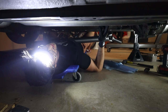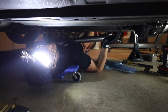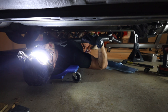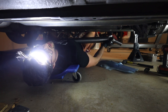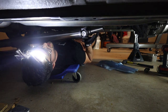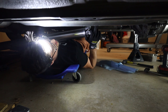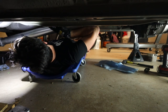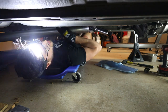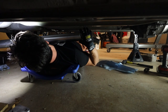I'm sure at some point you guys have noticed this plug, or I've mentioned it, but this plug is here so that the gear oil that I've already pre-filled my transmission with doesn't come spilling out while the engine is tipped at an angle while we're feeding it in. So, see if we can get this up here, the input shaft right here, the yoke that this guy is called, this input shaft obviously needs to go right where that is. I might have to do this kind of quick in terms of pulling that plug out and getting this guy put in. I don't know if you guys even have a great angle. Not really, but you get the gist.